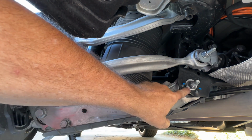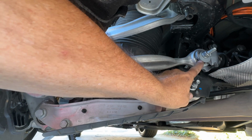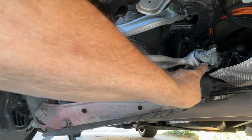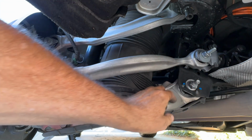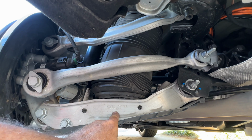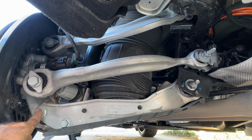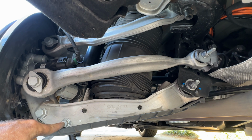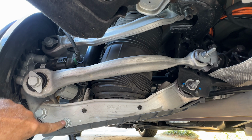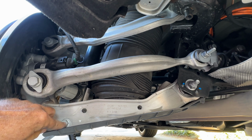So anyway, you can see you can adjust camber with this cam, and you can adjust static toe here. You still have to adjust the static toe. You got to center it, and then the steering will take over from there. The spring sits right here in the middle, so we're going to give it a 50% motion ratio from this point to the point where it attaches to the knuckle. This is the shock absorber's mounting point, and we're a little forward, so it's a little skewed. It's 80%. It might be a little better than 80%. I wouldn't go so far as to say 85, but somewhere in that range.